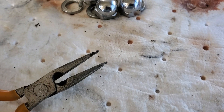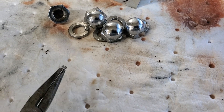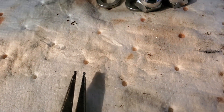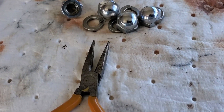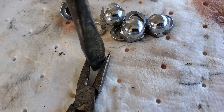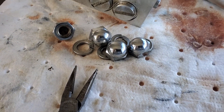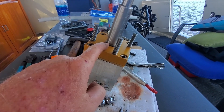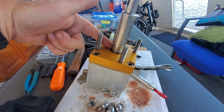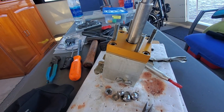Dolphins! Well, we fabricated snap ring pliers with this little pair of needle nose. I was able to grab the snap ring, then I put a big screwdriver in the middle and used the screwdriver to twist. It was not easy — took a while — but we got it done. I got the internal shaft seal on and the external shaft seal. Got it put back together and buttoned up. Going to try to get it put in.